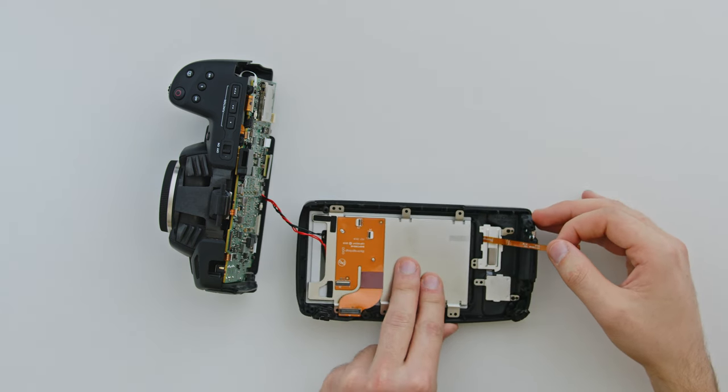Before bolting the camera enclosure back together, you need to test the display and camera to ensure everything is working normally. Add a V-mount battery and check that the mount locks onto the battery securely. Then switch the camera on and check that the screen switches on, displays the camera settings normally, and that touch control is functioning. Check that the menu and other buttons on the back of the camera work, and that the menu displays and works normally with touch control. With the V-mount battery attached, the voltage should display between 12 to 16.8 volts — tap on the battery icon to toggle this information. 16.8 volts indicates a full battery.